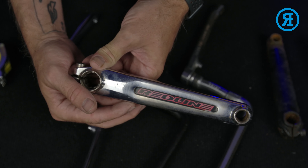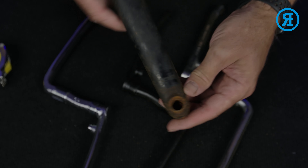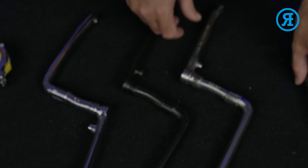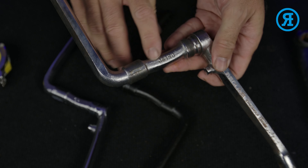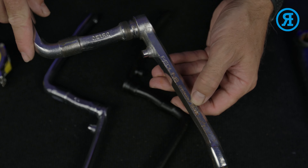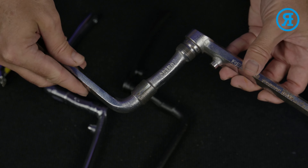As you can see here, these red lines are a 180. These DK profile cranks are a 170. These DK cranks are a 175 — very faint in there. And the one-piece, you'll tend to find the size on the inside of the axle, though sometimes they are stamped on the outside. These old red lines are a 180.